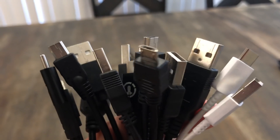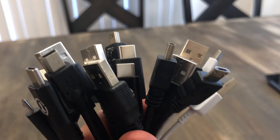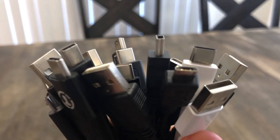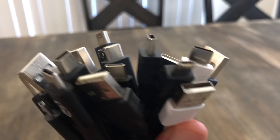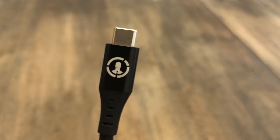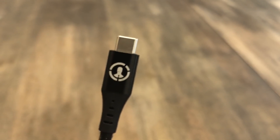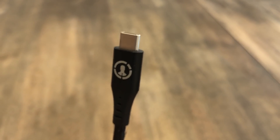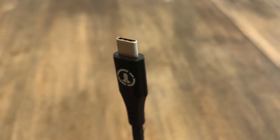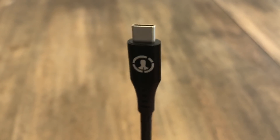One thing you want to keep in mind is that charging cables are not all the same — even USB-C to USB-C, there's a lot of differences. It's kind of like plumbing in your house: different fittings and different sizes carry different amounts of water, and in this case electricity. So the cable from JagoTech is the one I'd recommend. You can go on their website to see the actual rating — it supports 5V×3A, 9V×3A, 15V×3A, and 20V×2.25A. This is a really versatile charging cable and it supports 45 watt power delivery and higher, where some cables from Apple, Anker, and other big name brands don't always do that by default. And this cable is only $7 more when you buy the Tanker or the Tanker Elite — it's nice woven material.